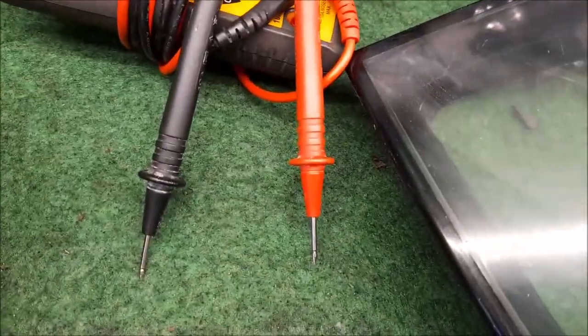I've been through the fuse panel and there's no specific fuse for that motor, so I'm scratching my head. I need to check in the C-pillar where the wiring comes through for the switch — see if there's power there and then chase it back to the fuse panel. The problem is the holes in the plug are so minuscule I can't even get a pin in them to get my probes into the switch to test it. I've got a plan though.